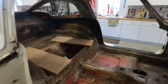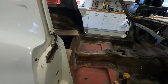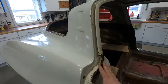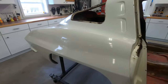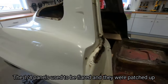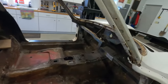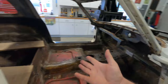Jumping to the inside, very quickly you can see one of the worst parts of the birdcage right here in the B-pillar where the roof connects — there's a big hole where there should be a gutter. That's definitely one of the problem areas you see on coupes, as well as the whole top of the gutter surround. But on this car the actual top part looks pretty nice. The worst is in the gutter, which they do reproduce, but there are some holes, so there's definitely going to be some repair work. To fix this we'll probably have to remove the quarter panel and the B-pillar fiberglass cover to get access, and also remove the gutter. Going to the front, there are some gutter issues but they reproduce that as well, and the structural stuff underneath is actually in pretty good shape.